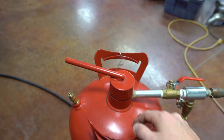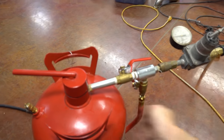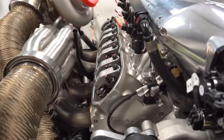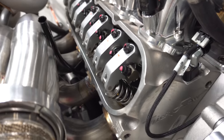We'll go ahead and pressurize it and start feeding it. Open up the valve and fill the tank with air — you can hear it, and now it's pretty quiet. We're turning over the flywheel with a flywheel wrench every so often. We don't have any plugs in it so there's not a lot of compression fighting us. We're checking for oil leaks — there's just a little drip coming out of the turbo feed so we know it's going all the way up to the turbos. We ended up pulling the valve cover off to put the dipstick in, and as you can see there's oil in the whole head.